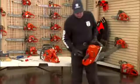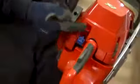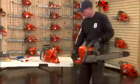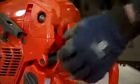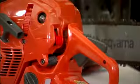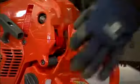When you have a cold saw, you pull out the choke. This saw here, you pull out the blue switch and it raises the stop switch to run, which is a great feature. On other saws, you can refer to operating instructions. This particular one integrates the choke, the stop, and the run all into one switch, which is very handy. It right now is in a run position.